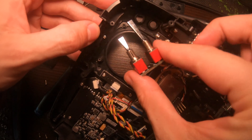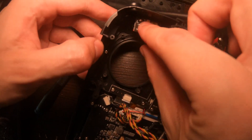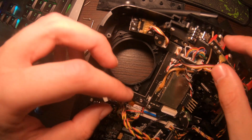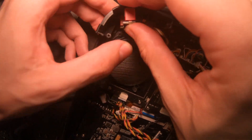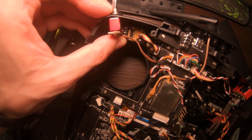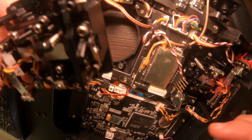Put the new switches in with the longer one at the right, and put the old switch back with the longer one closer to you. Put the nuts back on the front and rear, and you're basically done — just reassemble everything.